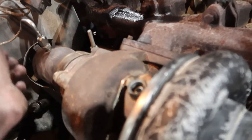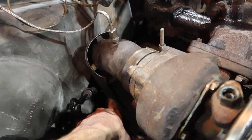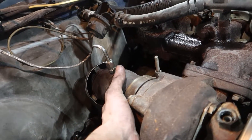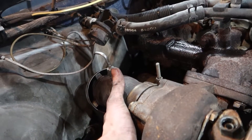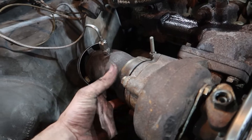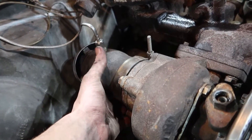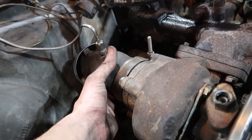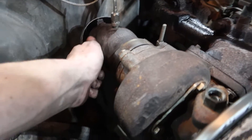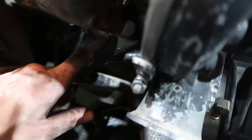What I ended up doing: there's a bolt down on the transmission adapter plate that holds the exhaust up — just undo that 13mm and the exhaust will move a little more freely. Definitely use a rather large pry bar to push it back, because it's a very tight fit. But once you get it pushed back and up, mated to the exhaust housing, just bump it a little bit with a hammer. Once the clamps are on, suck it down and it makes everything flush.